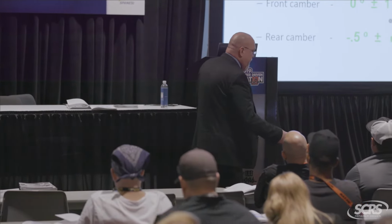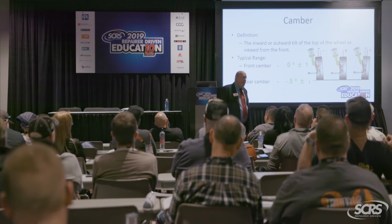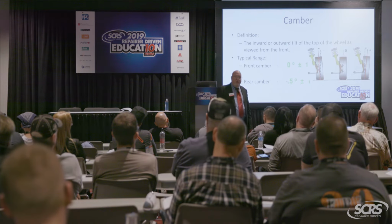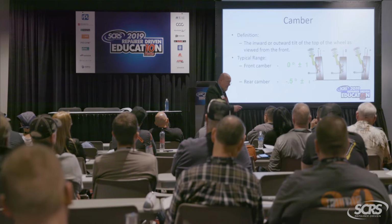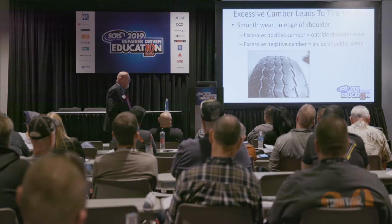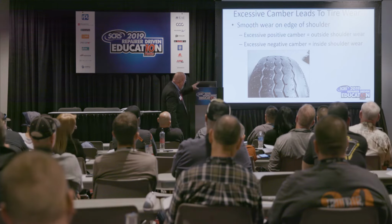I can tell you when I worked for that insurance company, a lot of my complaints happened 6, 7 months after the accident, and it was all due to tire wear. And then we'd go back and find out that the maintenance shop overlooked camber, and of course everybody would scream at me, you guys should never pay for that. No, we'd pay for it if you documented it and asked for it correctly, right? You see where I'm going with this? All right, so if it's in the red, it is an issue, needs to be addressed. It will lead to edge wear, even on the skinny tires. I picked a skinny tire for that picture just to prove that camber will damage that.